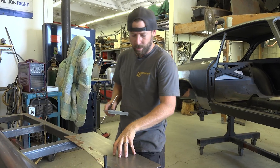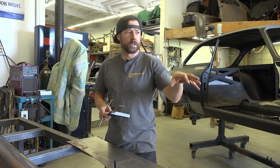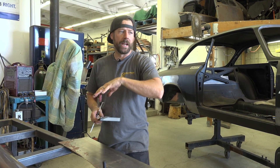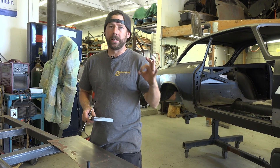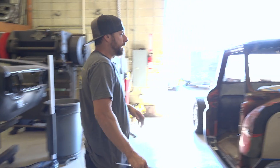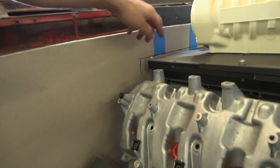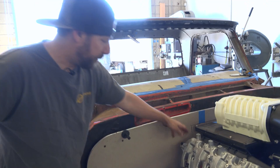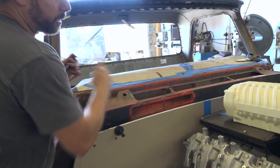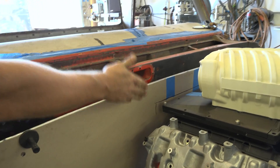I've got to make this piece that we're going to break up to 90 degrees. I'll punch some holes in it and it's going to bolt to the top of the intercooler — that gives clearance to the intercooler fittings on the back of the motor. Right now I just have it traced up here. We'll cut that out so I can put that plate on there. The plate will bolt to this, kick back, and then go down. So the back part of the firewall section needs to be recessed right to the back of that to clear the fittings on that intercooler.